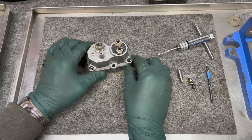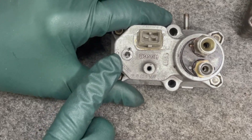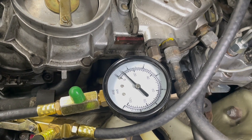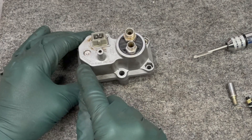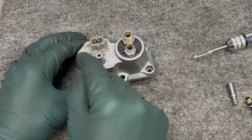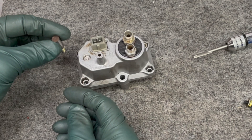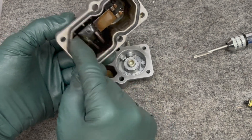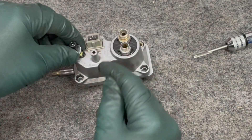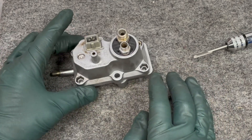Mercedes did this adjustment on the bench. During the process I learned something else — I said in the previous video I wasn't sure about having an adjustable pin on the cold start adjustment, but I've changed my mind. We overshot it a couple of times because when you're tapping it's not linear; you'll tap one millimeter and suddenly you've gone too far. Same with the adjustment on the bottom. Having the ability to pull that pin back up is valuable — you can see here you're driving this pin down, and if you drive it too far you'd normally have to take it apart and tap it back up. With this adjustment, you can tap it down and if you go too far, tighten the nut and it acts like a puller to pull it back up.